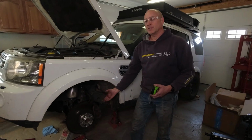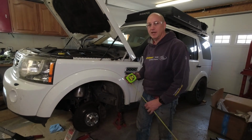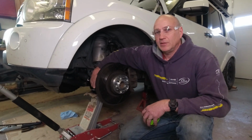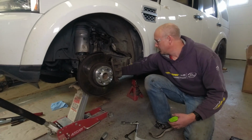We put some pressure underneath the control arm so that we can collapse the suspension to get it to the proper ride height, measured from the center of the wheel arch to the center of the hub so that it's at the right spot. So when we go in here, we need to torque all of these down. This one back here, and then there's one in the back right over here. That's hard to get to.